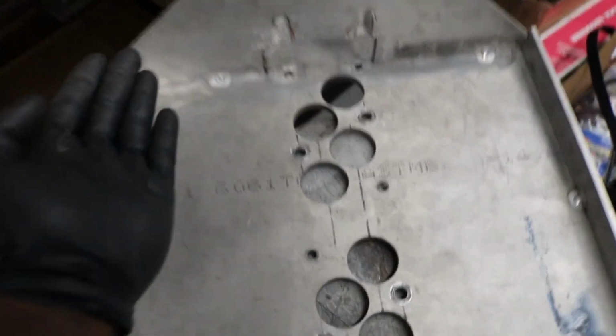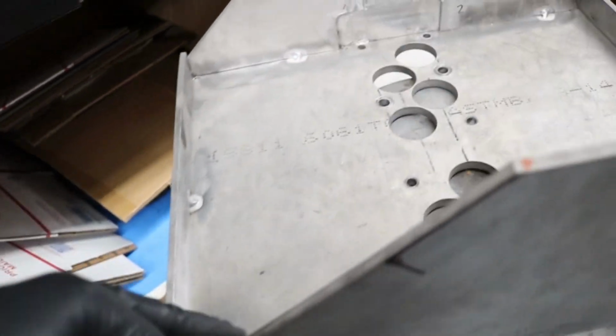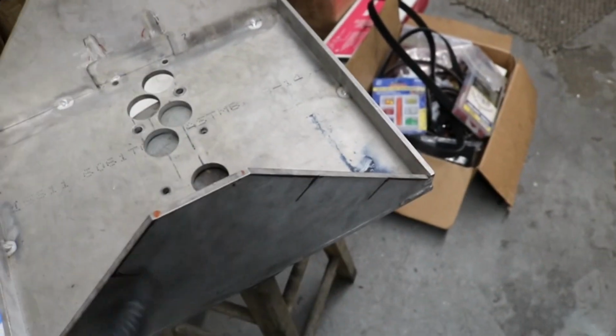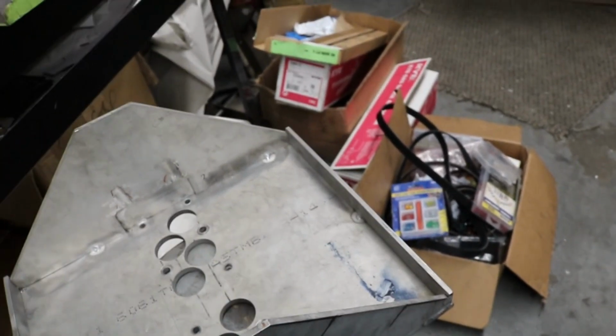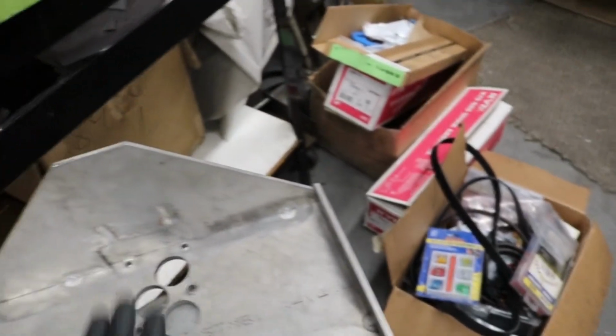On the inside, I'm gonna have a plate going from this line to the base, so like that, going across like that. All right. That's designed to give it a little bit of rigidity too, to stop it from kind of buckling down. So this stops it from buckling down at the top. This one kind of keeps it sturdy at the bottom. That's my way of trying to tie in both the upper and lower. And then also the cap here as well will tie both of these together to give it some more rigidity.